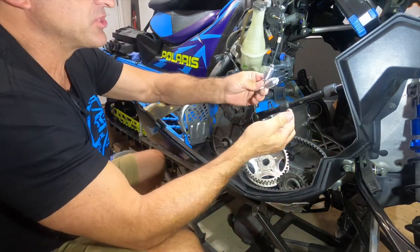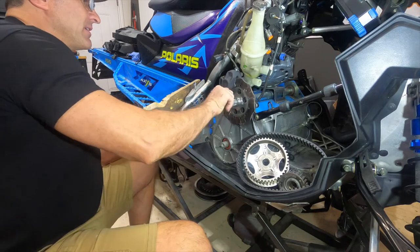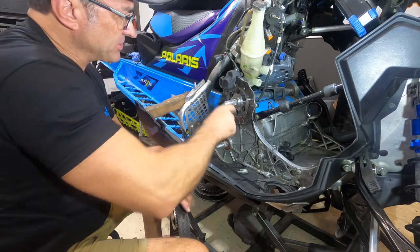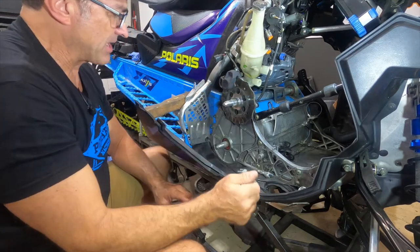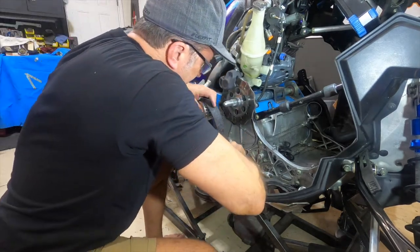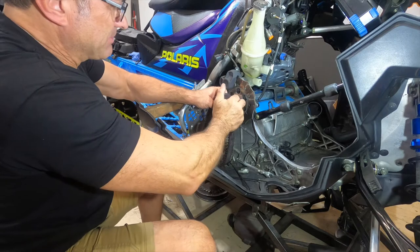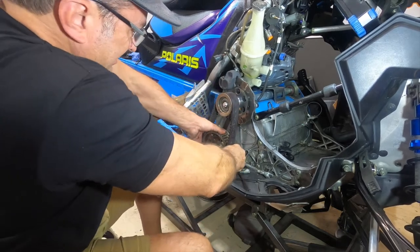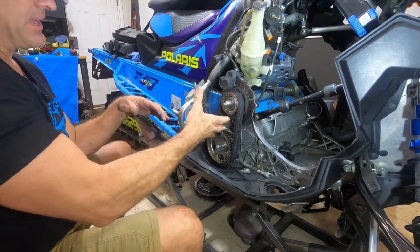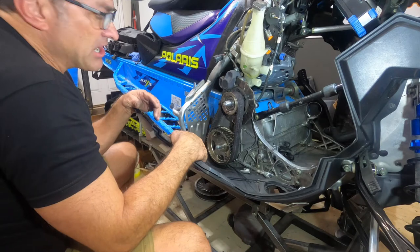These are the little tapered aluminum parts — I got these from Kurtz Polaris, ordered them online. They just screw in, one in each hole, finger tight so they come out really easy. The next thing I do is put my belt on and get the bottom one started — it's a little tight because the plastic is tight down around there. You just want to get the teeth started, same thing with the upper one, and you can usually just slide these on. Once both are on, you just unscrew the tapered pieces and the belt's on. Then put your bolts in, put some blue Loctite on them, and torque those down.